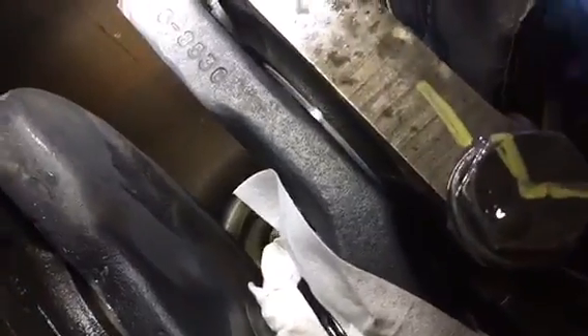On all the throws of the crank I wrap tape around them — it helps protect everything when I'm putting the crank in. After I clean the crank out with solvent and blow it out, I try to keep it as clean as I can. You really want to keep dirt, dust, grime, and anything metal out of there to avoid scoring the crank and messing up your bearings. When you get to do an out-of-frame complete engine build from the bare block up, you really want it to be like brand new — it'd be a shame to screw anything up.